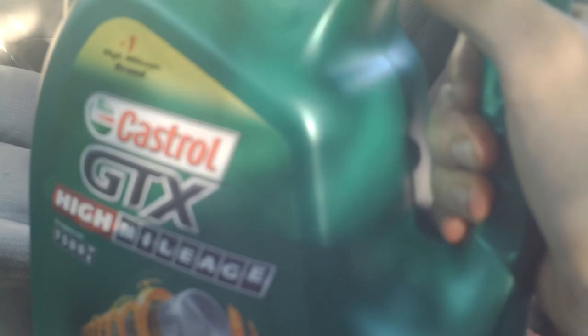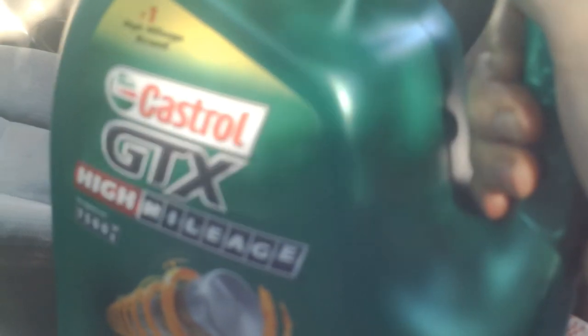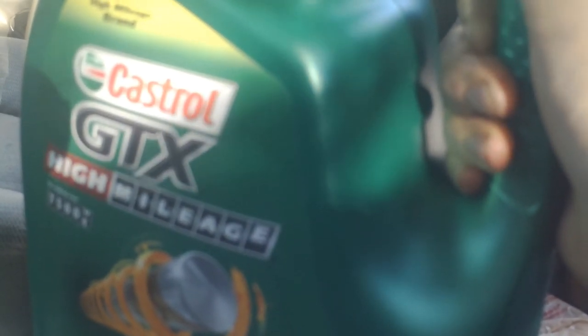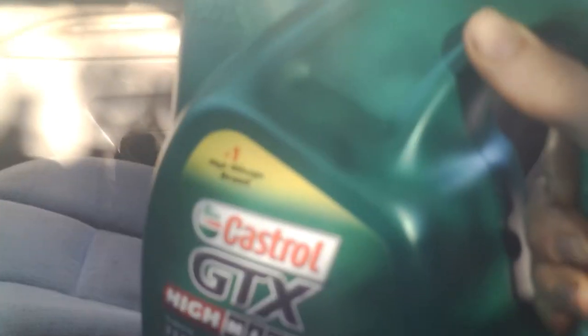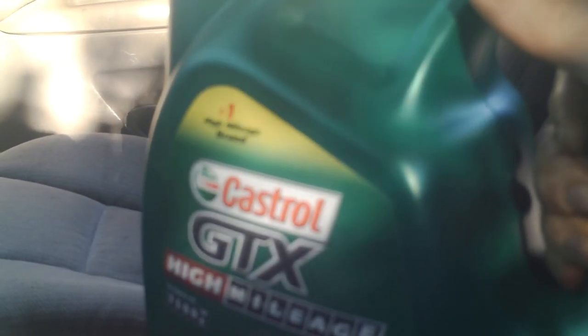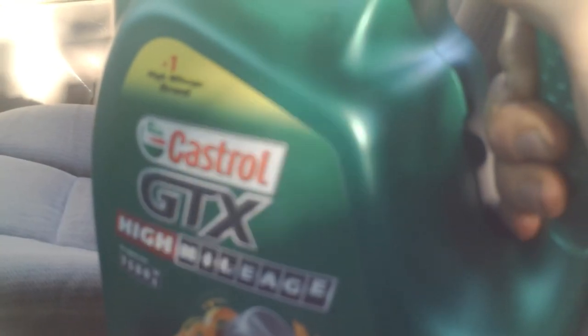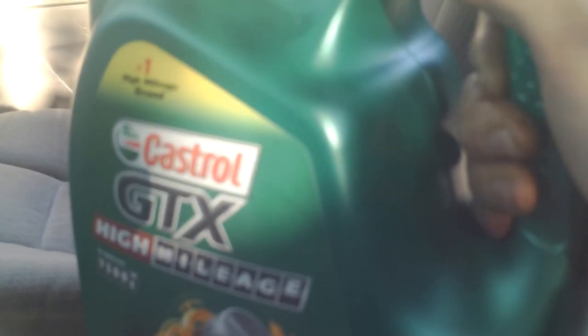So what I did was I went ahead and I got my 10W30 and my filter. Now your auto parts store should be able to tell you what kind of oil filter you have. Unfortunately, AutoZone kind of failed on this one, because they told me that for every vehicle they had looked up that was a 1996 F-250 XLT like this, they had 5W20 in their computer. If I hadn't seen that sticker, I would have been in trouble because I would have gotten 5W20 and not known.